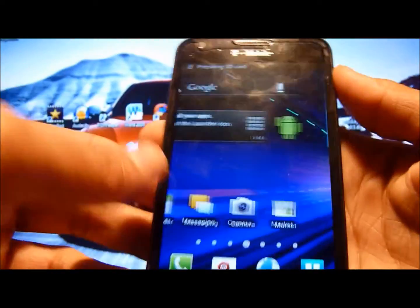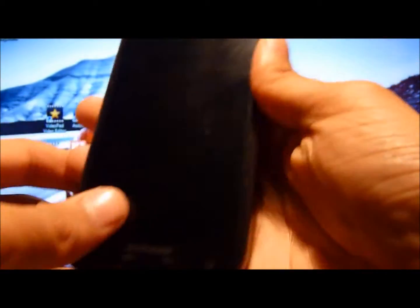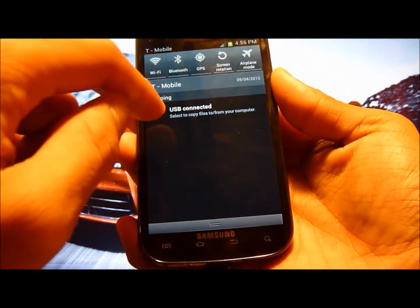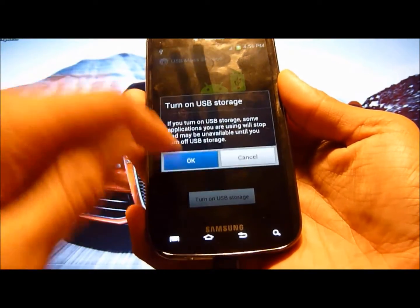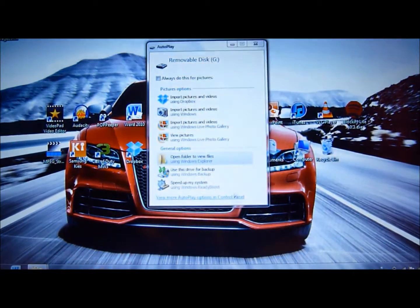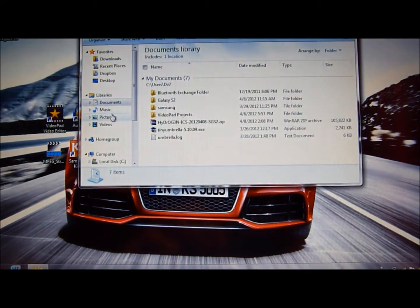It is on — it's my custom ROM. First thing, plug it in. Just swipe down, tap on USB connector, and you want to turn on USB storage. Wait until it turns orange. Now you can set it aside for now. These two windows popped up — I just closed both of them. But if you know which one's your SD card, just go right ahead.